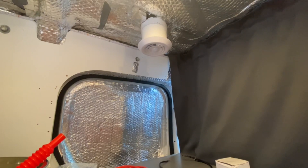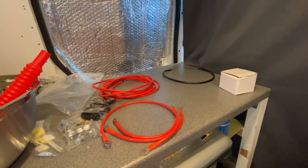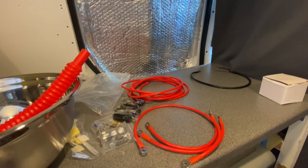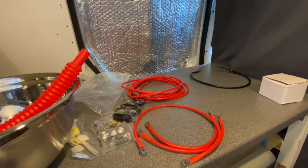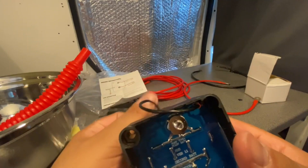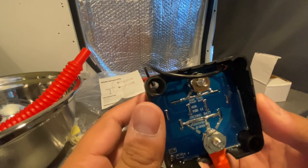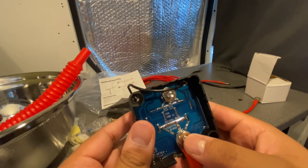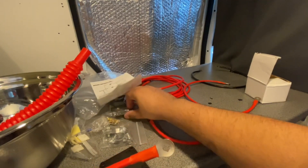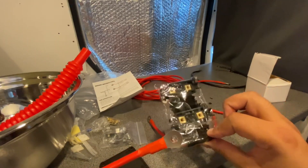There are plenty of videos on YouTube so I'm not going to show the step-by-step process — I'll just show you the small things I complete as I go along. Alright, step one done. The top connection is from your positive starter battery — your van battery — and this part goes to your leisure battery. I've connected this wire up and it's now going to one of the fuses, and from the fuse it will go to the battery.